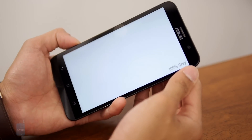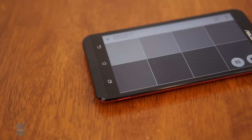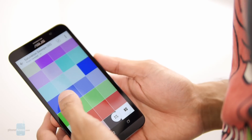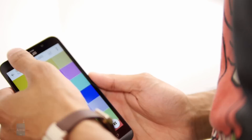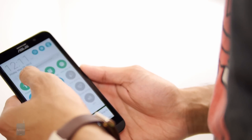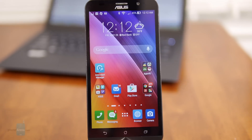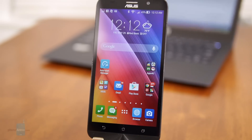Diving deeper into the display's other characteristics, it exudes a colder tone due to its color temperature of 7622 Kelvin. In addition, its 2.8 gamma value tells us various shades of gray appear darker than intended. Even though it doesn't hit all the target values in the sRGB color chart, it's still not as saturated as some other displays, nor is it blinding with its 442-nit luminance. All told, the display is pretty ordinary — it gets the job done, but lacks characteristics to really command our attention.